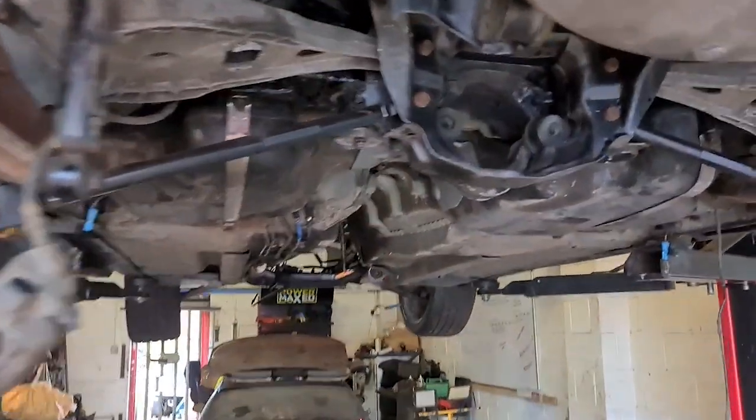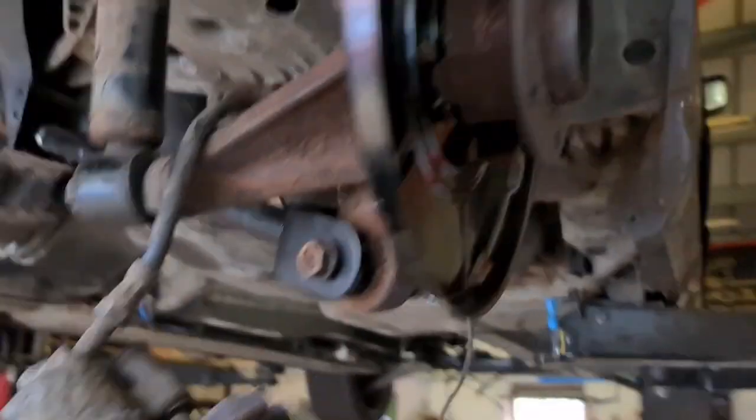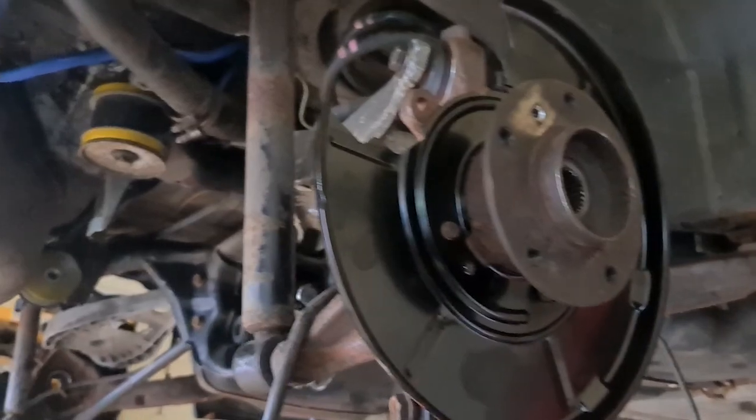The subframe is all fitted, back on the car. I need to weld the diff before I refit that, and I can't put the drive shafts in yet because I need to pull the hubs off to swap the backing plate round and swap the bearings. I'll get bearings Monday morning — it's Saturday now so I can't get them today. I'll get them Monday and refit them. I'll do another episode next week. Hopefully I'll get the engine out of the other car and ready to go into this one. My other car — I snapped the drive shaft this morning, so I won't be driving that again; there's only six days MOT left on it anyway. I've got the engine pulled, a few new parts just arrived, so I'll show you them in the next video. Thanks for watching.